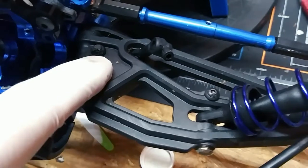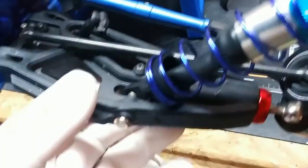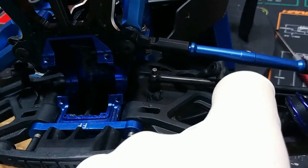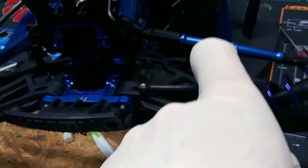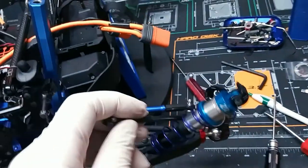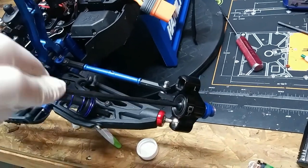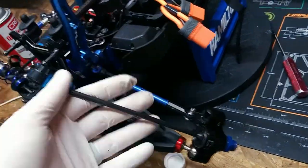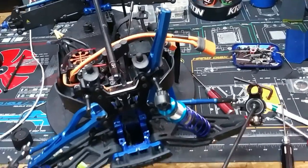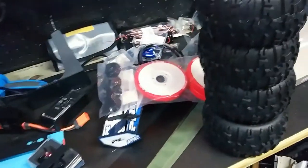See, it just dug them right out. If you take the dog bone, it fits perfectly inside that hole — and it just tore the inside up on each side. When it did that it bent these pieces — look how hard it is to turn that, it's pretty stiff. So both of them have to be replaced; I already ordered those, they're on the way. I'm fixing to rebuild that diff and do all this, but there's something else I want to show you guys.